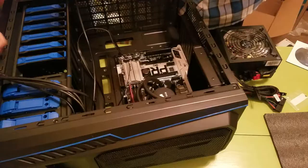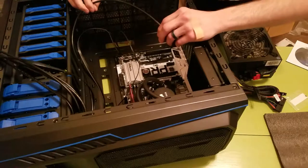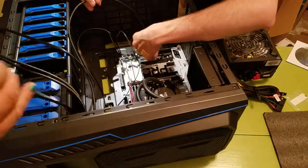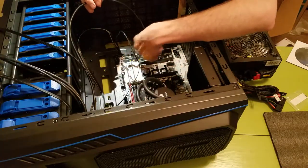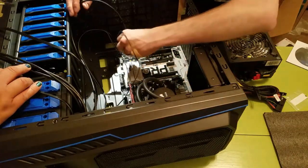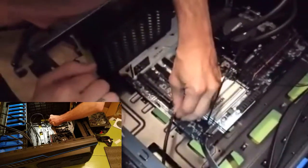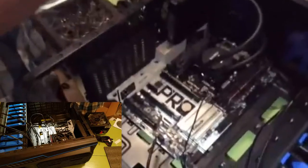Alright, this is USB. Is this the 2.0, I take it? This is your USB 3.2, and this is your HD audio. They didn't even bother to include USB 2 on this board. So we'll go 3 and 4, because I'm assuming USB, that one is that one. Then matching up pinouts is pretty self-explanatory. HD audio goes here. Again, here's the missing pin to missing pin. And this is the USB 3.